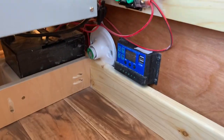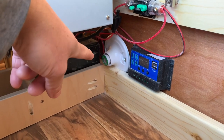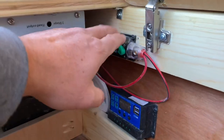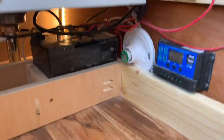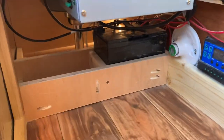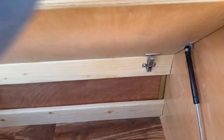That's also where we keep the solar conditioner if you get solar, and the fuse for the AC power if you go with that setup. This is a kill switch — so if you're storing it inside and not getting solar, you can kill power so you're not slowly draining your battery. This is a battery charger right here, and down below is where you keep the battery, with a little bit of storage and a spot for a secondary battery if you wanted to add one.